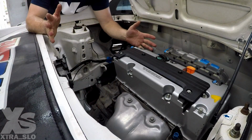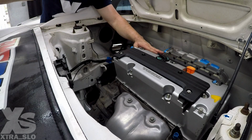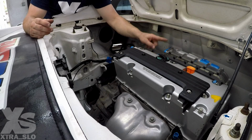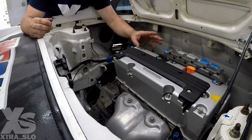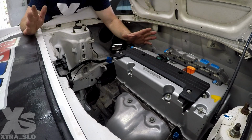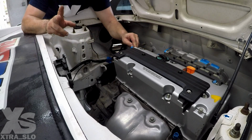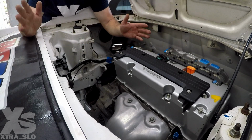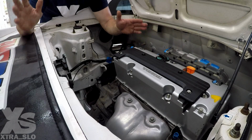Now, hopefully that better explains exactly why I said we're going with 1000cc injectors first, okay? Because we're doing 1000cc injectors with a 64, 66, and when this engine finally gets built, we're not going to be running 8 injectors like a lot of people do on these fully built engines, even though it has 8 injector capability on this Skunk 2 race intake manifold back here. Instead we'll be running the brand new ID 2600cc injectors. Right now, that would be beyond overkill for the next year plus as we're running this on the stock motor, so I didn't want to jump way ahead. The price difference is over triple between the thousands and those 2600s. Totally makes sense, obviously, but it was just going to be a waste of money, so we decided to go with 1000cc's for now. Eventually, we'll hopefully get a couple bucks back out of those, sell our 64, 66. But again, in the meantime, that's the exact setup we want to do.